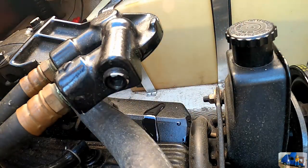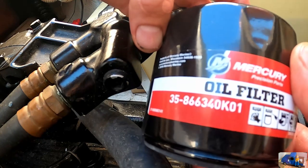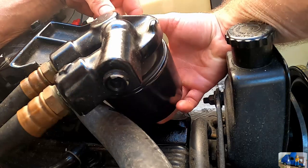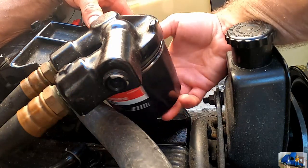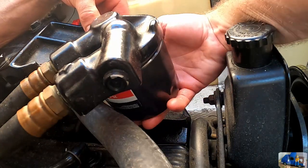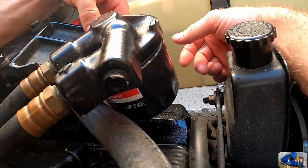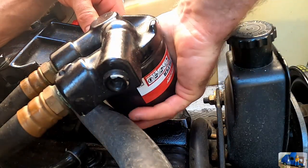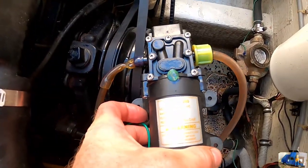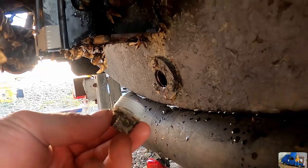The part number there. I think this one might be for our outboard, but it's basically the same as the OEM. Maybe a high performance one or something. We had a massive problem taking it off because the plastic bag we tried to use wasn't working very good. Usually it's a grocery bag. And when I squeezed it to remove it with those junk filter pliers, it made it come out the top. Need a good filter wrench. Finally, I think it's done. Don't pull a rookie mistake and forget the plug.